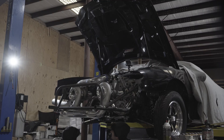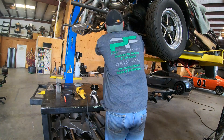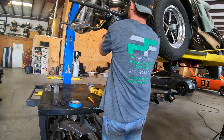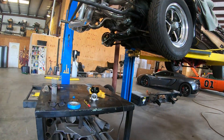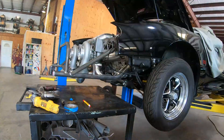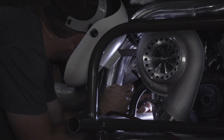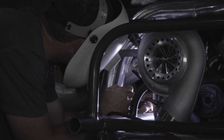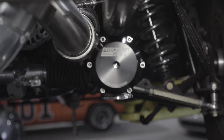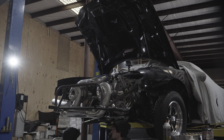Ideally the best place for the wastegate to go would be right after this bend — in the bend straight — so the air is going into the bend and into the wastegate before it has to bend down, or in any other similar spot like that. What you don't want to do is find a straight piece of pipe and go right into the side of it. It's just not going to function well — it'll work to a certain extent, but it's going to end up overboosting because the flow isn't smooth into the wastegate.